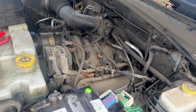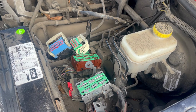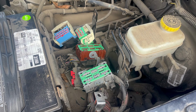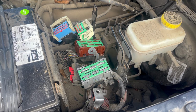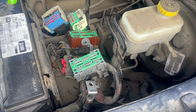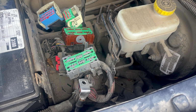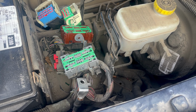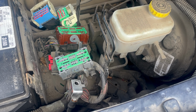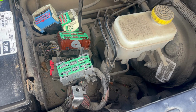So I'm just gonna grab that TIPM and position it over here, and I'm gonna install those clips off camera. There's no point showing that, it's pretty straightforward. Just remember, when you're installing each of those clips, get them square, push them in by hand a little bit, and then you'll feel that lever start to close a little bit, and just kind of push with your hand on the connector and the lever and pull it into place, and it'll snap right in.